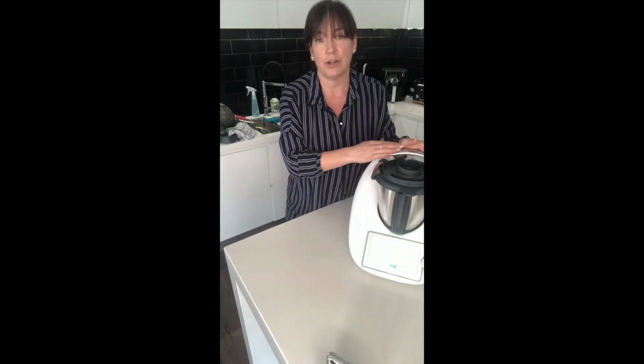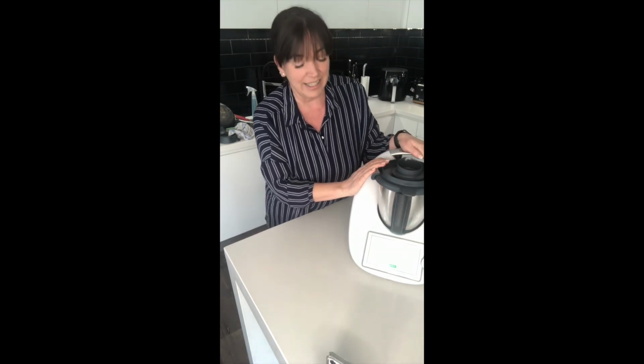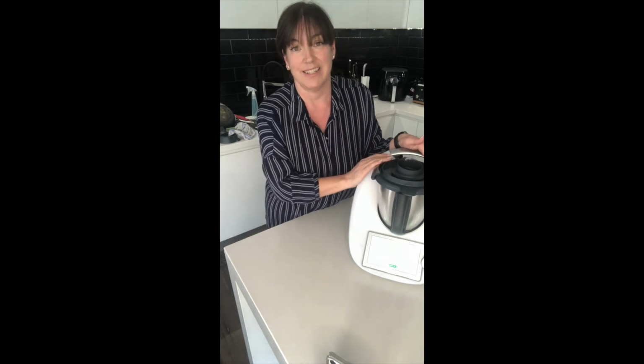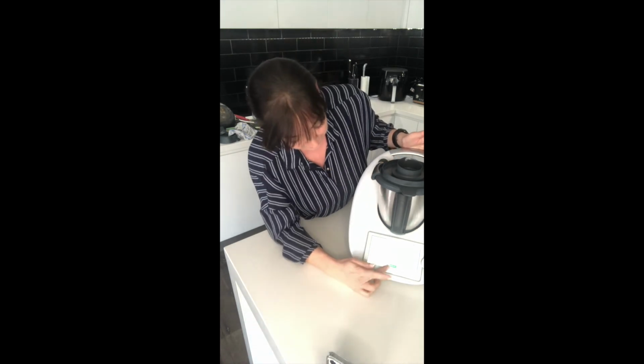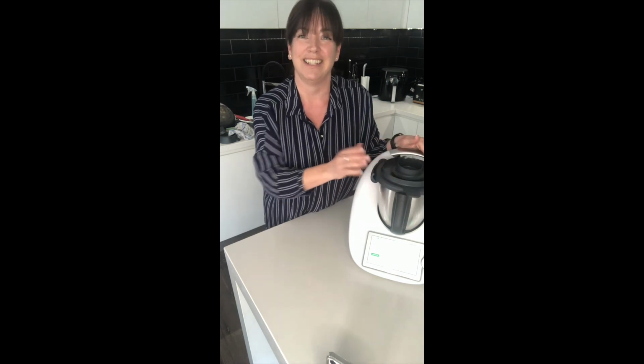So if you come across the arms locking the bowl and they're not letting it go, check the two things, that you are potentially in turbo mode or maybe accidentally went into transportation mode. If you're getting out of it, voila, your machine will automatically release the lid and you can continue cooking.